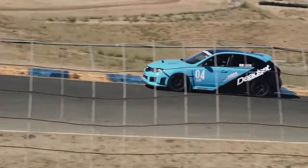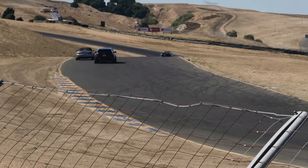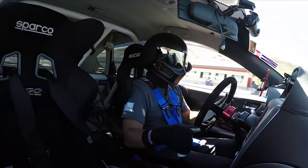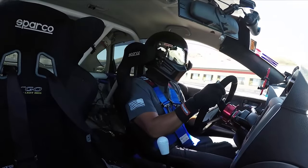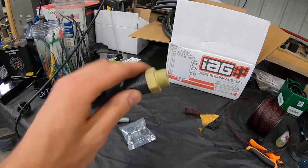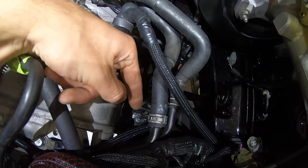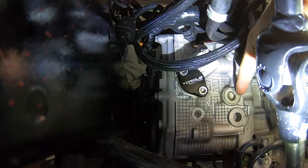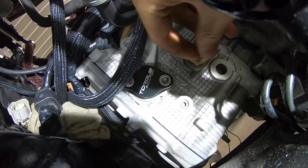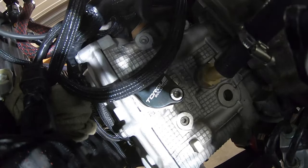Next is something we recommend doing to your WRX if you plan on taking it to a lot of track days, because you're going to get that little EJ up to some very high temperatures — so hot that part of the engine won't receive enough cooling from the original factory setup. To prevent this, installing the cylinder 4 cooling chamber mod is pretty crucial to making sure that stagnant coolant gets evacuated quickly enough so it doesn't boil and cause detonation or hot spots.